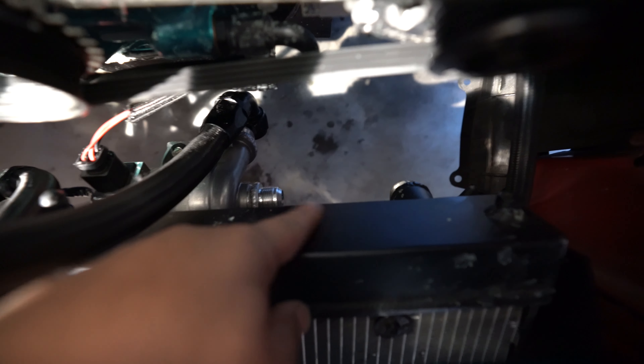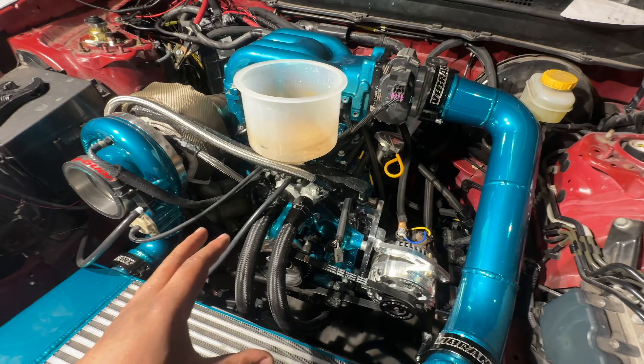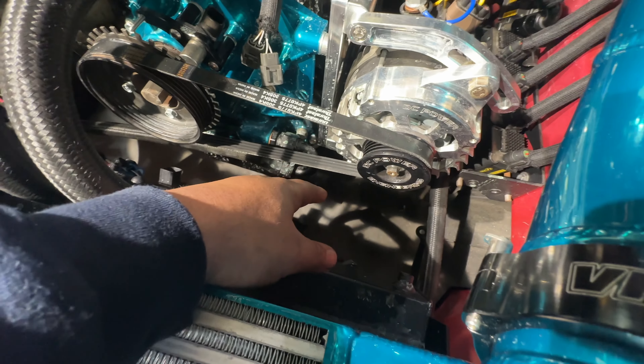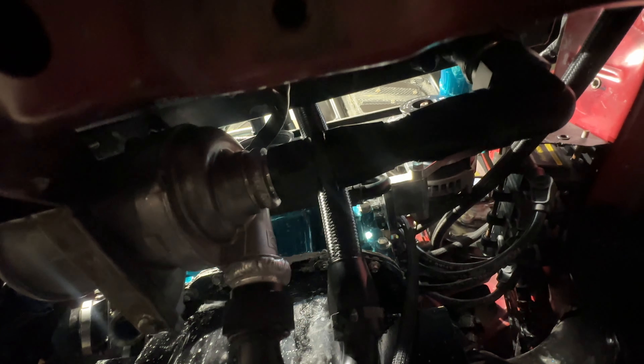I'm going to have to make new lines for the one coming out of the radiator and to the water pump. It's going to be a very short line — literally like no line at all, basically fitting to fitting. Then this one I will remake and it'll be a 180 or 150 to this line and it'll come up here. This clip is on my phone but I wanted to show you guys. I got a new line — I just remade this one. So before it was coming down over here and I had it hanging. What I did is had it coming down, go onto the car. We can see the water pump — now we've got this line coming straight out of the radiator, drops down into the water pump, comes out and goes up. I think that'll be a lot better.